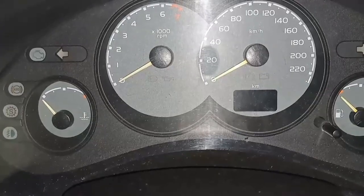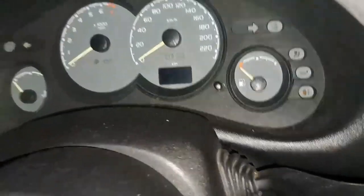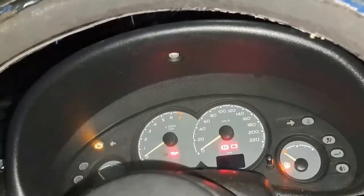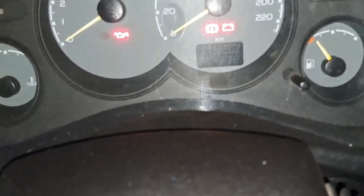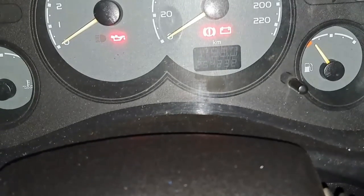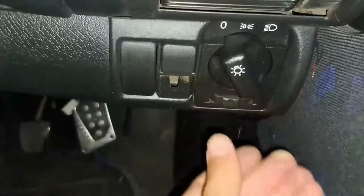Okay, here is our second little problem. You guys can see the dash is not displaying anything — not the dash, but the kilos, where the speedometer and so on is. So yeah, it's not displaying anything. If we switch on the car, it's supposed to show you something. Originally I thought maybe it's the fuse, but if you can see nicely, you can actually see there's something there — it's displayed, it's just not bright enough. That's the issue. The switch works, but what is not working is this illumination button. This switch came out with this illumination thing and I think that's what's broken.